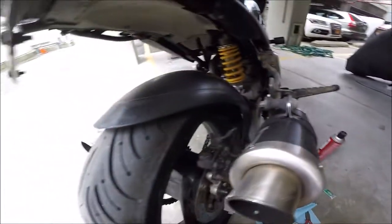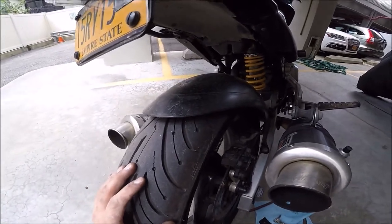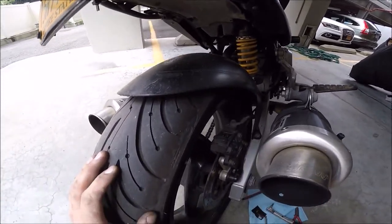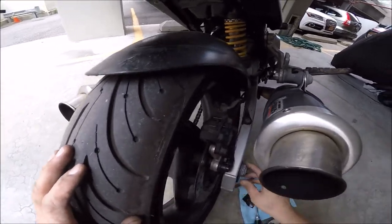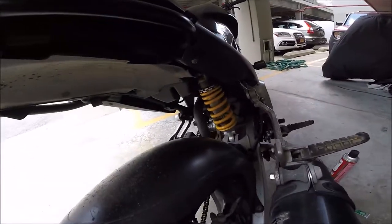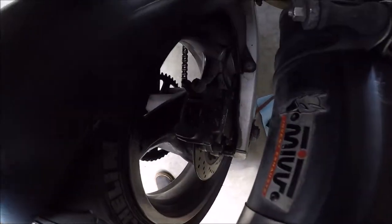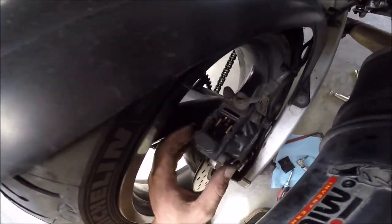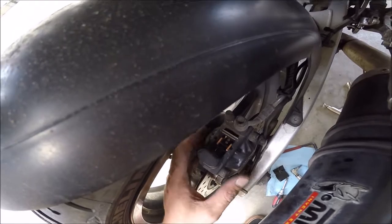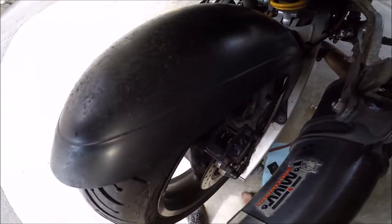At this point, you take the bike out for a test ride and listen for noises. Make sure everything is okay — just go around the block, don't go fast, make sure the brake works. Thank you for watching, bye-bye. Now that everything has been assembled, this is what the caliper looks like. You can see two fresh brake pads. The clip is in, the pin is in, everything is tight. We're good to go.